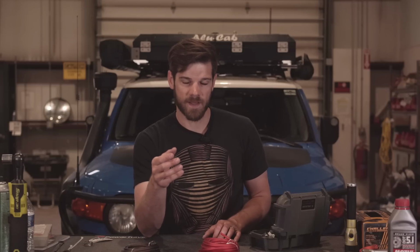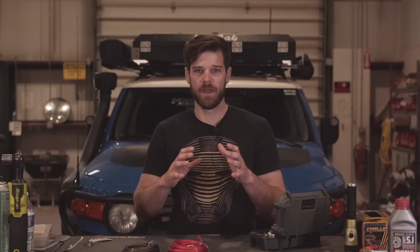The disadvantage of a lithium is they have limitations on how much amperage they can output at any given time. I will not be able to use the new lithium battery for winching at all. It's only a 60 amp continuous rating, which is fine because I'm running a refrigerator, which takes maybe 5 amps at most, and all LED lights and stuff. But the lithium is going to fit my type of camping better. My solar is going to work way better. I like fiddling with things, so I'm going to put another battery system in this.